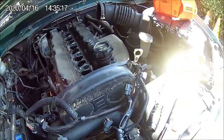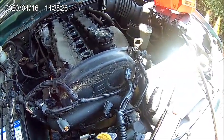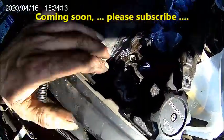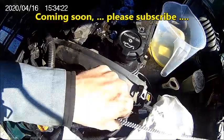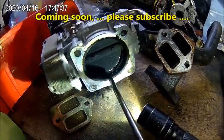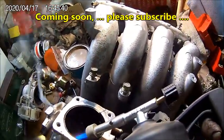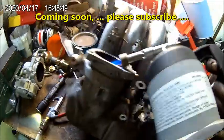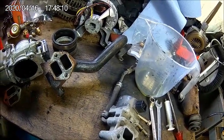I don't have any walnut shells, so we'll just do it with some solvent. We came up with this idea: move the cylinder to TDC, fill the intake with kerosene, and then use a pipe brush. That's all crud coming out — definitely worth it. More coal harvesting here. Because I can't get that ring out — tried everything — we could do it the old two-stroke way and just burn it away. Thanks for watching and subscribing — until next time.